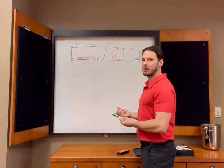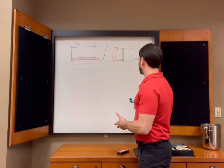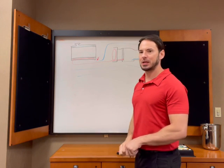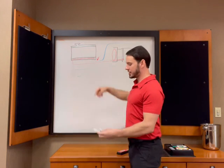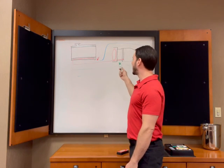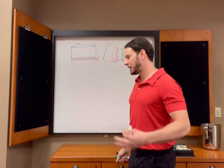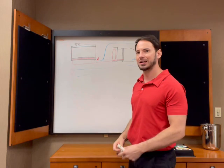Attached to the low underside of the valve body is a temperature sensor. And so that's where I'm concerned about the fluid temperature. This is a big misconception that I see a lot, because over here on the 92s, you have a filter in here, and a lot of people say, man, that's a great spot to pop in a new filter and put a temperature sensor in there.